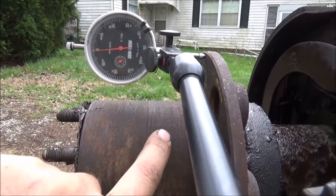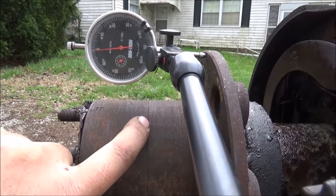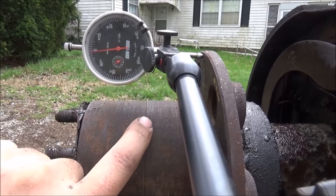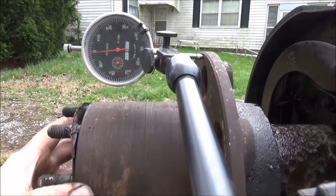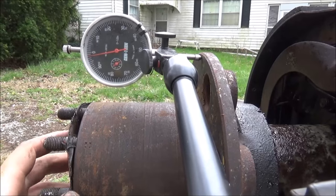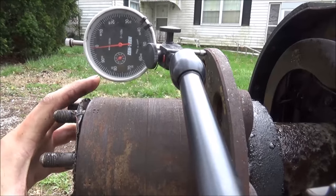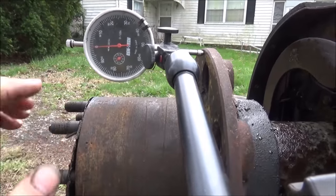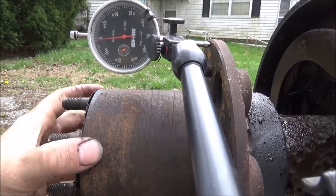You can see where they backed the tool off and the tool drug spiraled out when it was coming out, because they were cutting it so fast with so much pressure that the tool was deflected, and when it spun back out, it left marks in it where it basically cleaned out when it was coming out. There's some jaw chuck marks. Must have had a 6 jaw on this. Nice little witness marks.